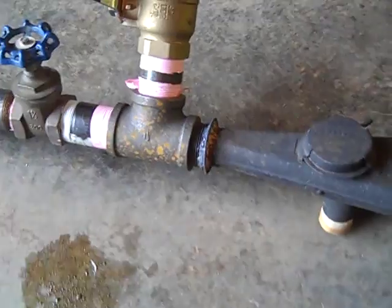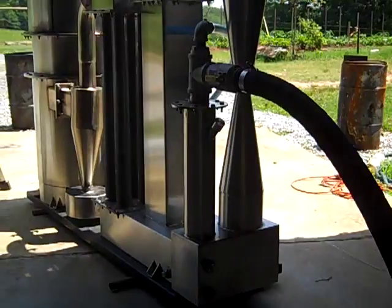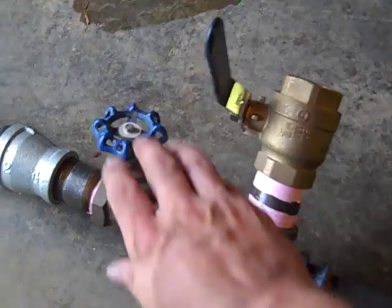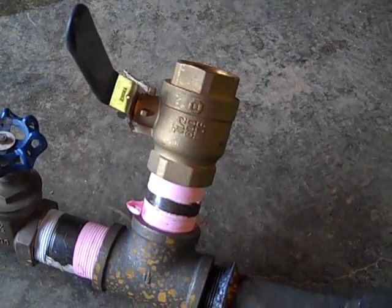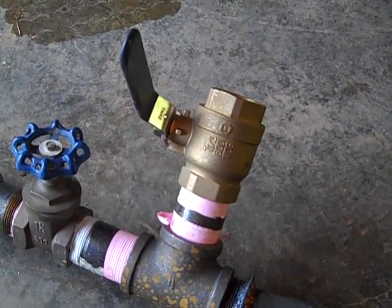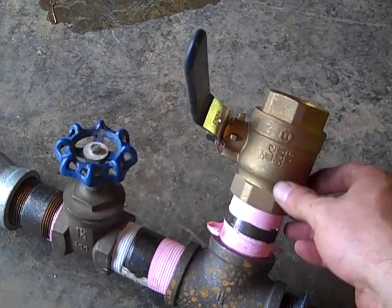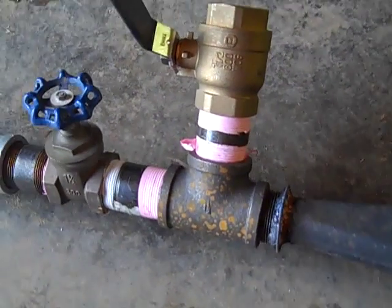This is the wood gas setup to run in the truck. I have it outside the truck and hooked up to the gasifier, running the gas down. I have my shutoff valve and my air-gas mixture valve here. I plan to go to more of a butterfly valve, and the truck has a choke cable that I plan on hooking to that valve so I can adjust the air mixture from inside the truck.